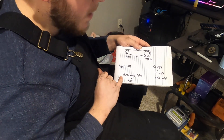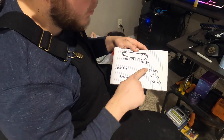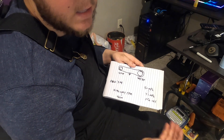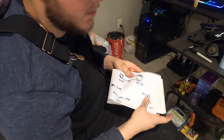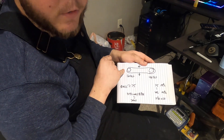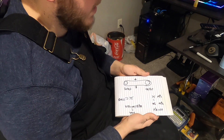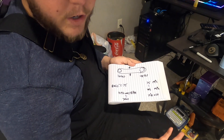My highway RPM at around 70-75 actual miles per hour was about 8,200 RPM — not great. That was my big thing with this bike: it's made to be a city bike, not for highways and interstates all the time at high RPM. With our upgrade, we put a 16-tooth front sprocket on. It's going to be less torquey, a little more sluggish accelerating, but better at cruising — which I think is perfectly fine. I spend more time in sixth gear at highway speeds than ripping through turns.